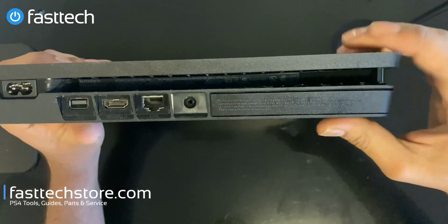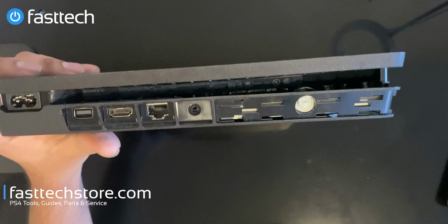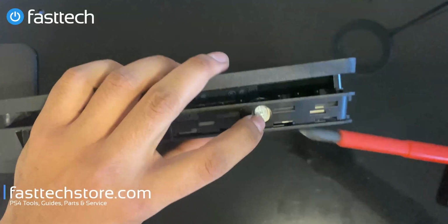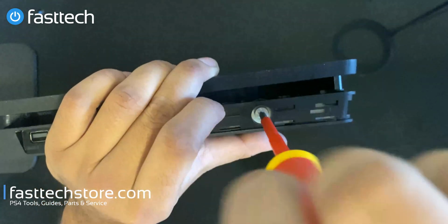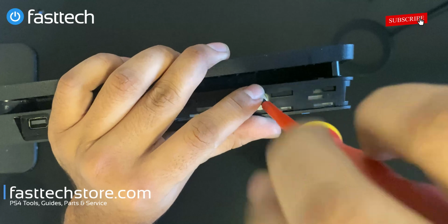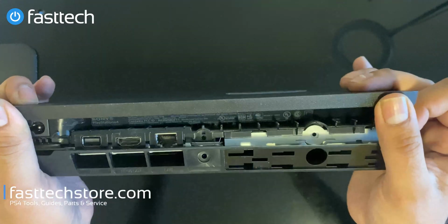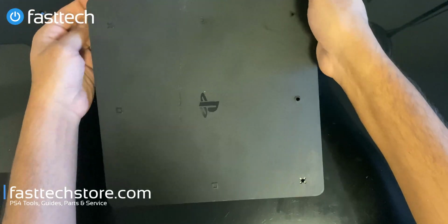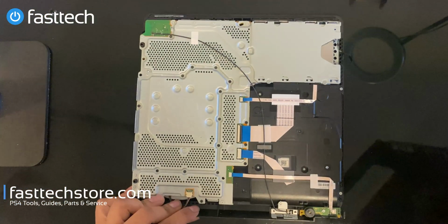For the next step, we're gonna remove the hard drive cover, like so. There's gonna be a Phillips screw that we're gonna remove. You're gonna need a Phillips screwdriver, which is gonna be included in our kit, or you can buy it separately from the link in the description box. Then we're gonna remove the bottom panel like so. It's gonna come right off. Push a little bit, and then it should come off from the front.